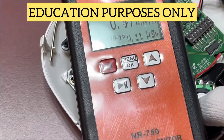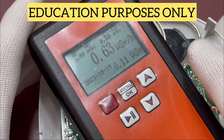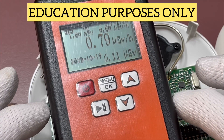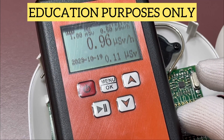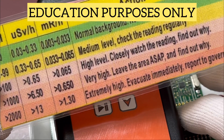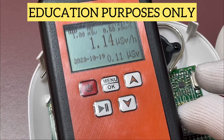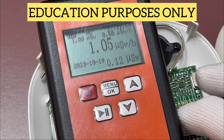We'll pull it off that one and get it on this newer one here, set it right on there, and check what the level is. This smoke alarm is only about a year or two old and you can see it's jumping up much higher now. We're almost hitting 1.0 micro sieverts, and as you can see we're getting up to the high level or past the high level. We know that it's high because we're sitting right on top of the americium-241 inside the smoke detector.